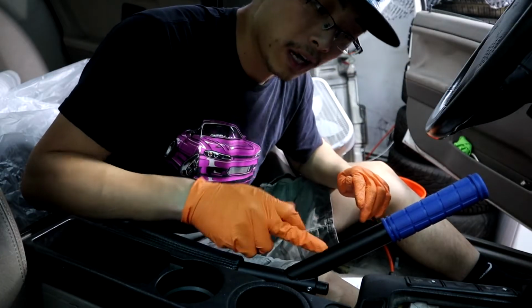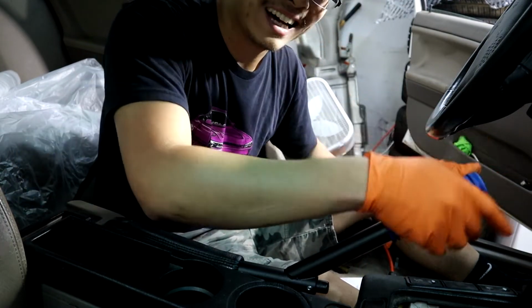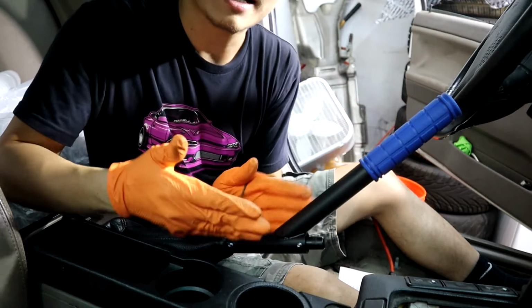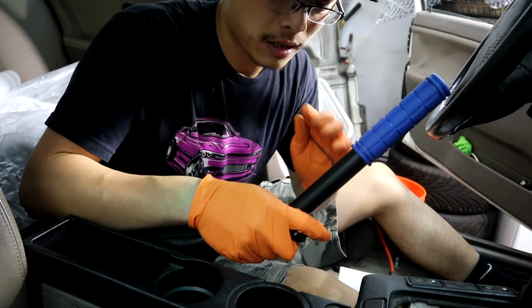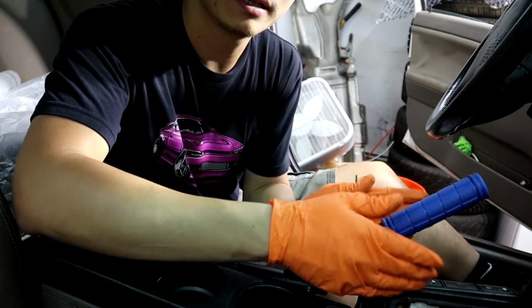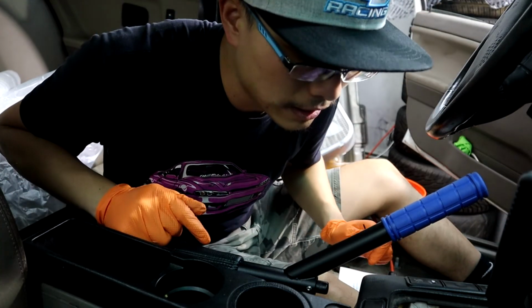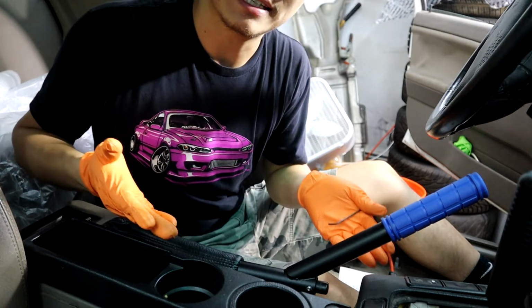After this, I recommend you do at least some sort of test drive. Not like grabbing the handbrake in the middle of driving, but just to see if you like the position and if you need to readjust it, because this is actually not straight up. It's tilting towards the driver's side. The reason is, once you drop it down, if you put it dead in the middle, it's going to interfere with the shifter. I need to readjust the shifter as well now that I'm here. I'll figure it out later. But anyways, that's it for the installation.